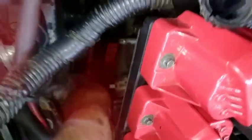And then you gotta unplug the crank sensor and the cam position sensor and snake these wires up between the coolant neck off of the timing chain cover, go into the radiator. The wires go right between this and the block and then comes up right here between the bracket and the head.